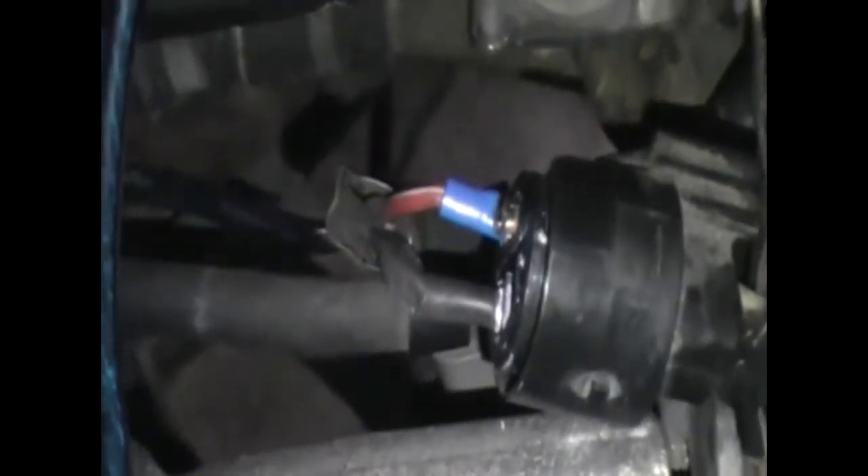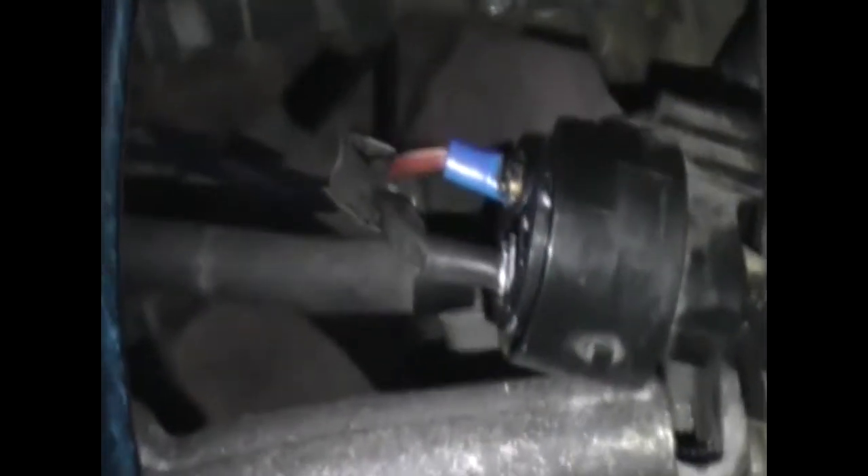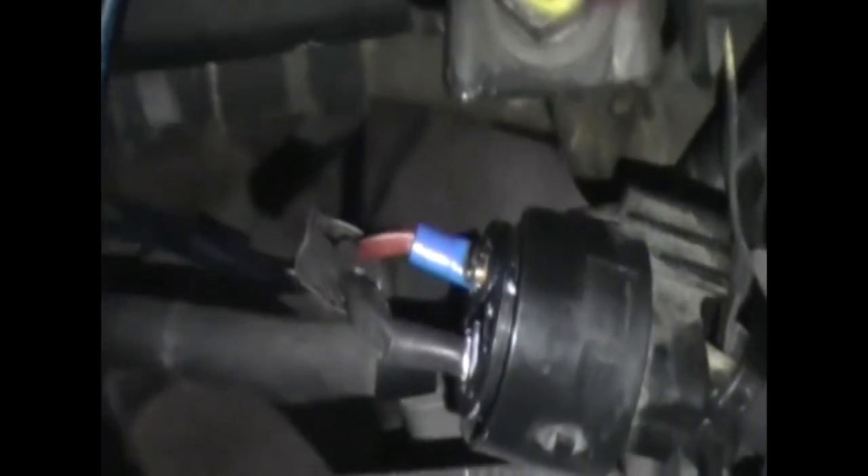She's all in, she's tight, everything's looking good. I've got the wiring plug — according to Google Images, S is the top connection, L is the one on the left, and IG is on the right. This alternator doesn't have IG so I shouldn't need it. We'll go start her up in the van now and see if there's any charge. I don't have all the wiring tidied up yet but that's no drama — I just want to confirm it's working, then I can cable-tie and cover the wires.